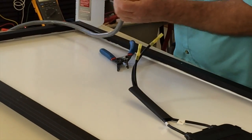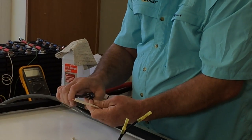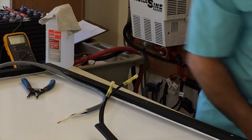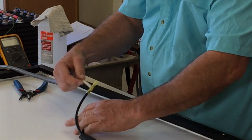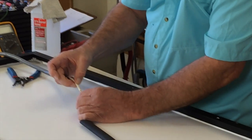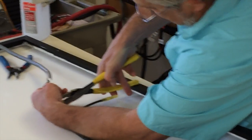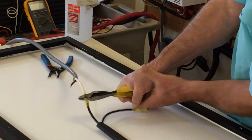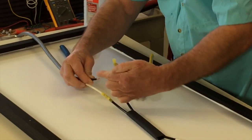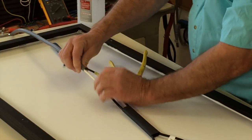Now I've got to strip these ends — same, about three-eighths of an inch. We're going to crimp these together. White is minus — let's put these together. Do our crimp on that, do the pull test, and then crimp the other one. Do a twist on that copper — it keeps it so it'll fit into the barrel inside the connector. So now we have these two wires together.